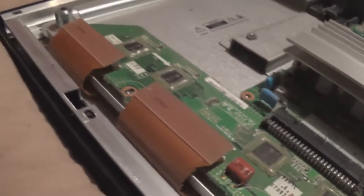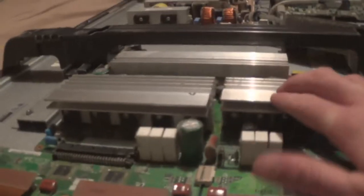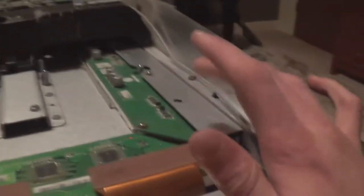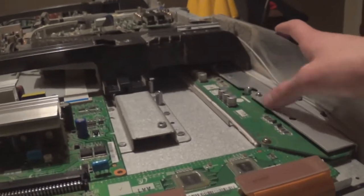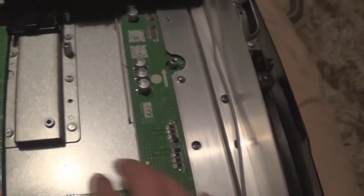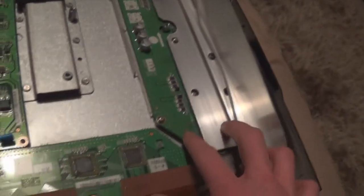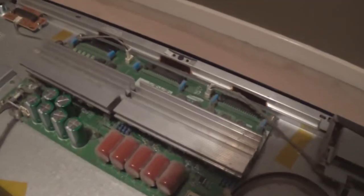I've had to repair a couple and it was not easy. These are very little copper wires in them that go to each row on the screen. The Y-Main's job is to address and light up every row on the screen when it's being requested. The E-Buffer addresses the vertical rows which has all the colours - red, green, or blue pixel. This just creates a high voltage for it. And then the X-Main basically just keeps all the pixels pre-lit and also discharges them when requested.